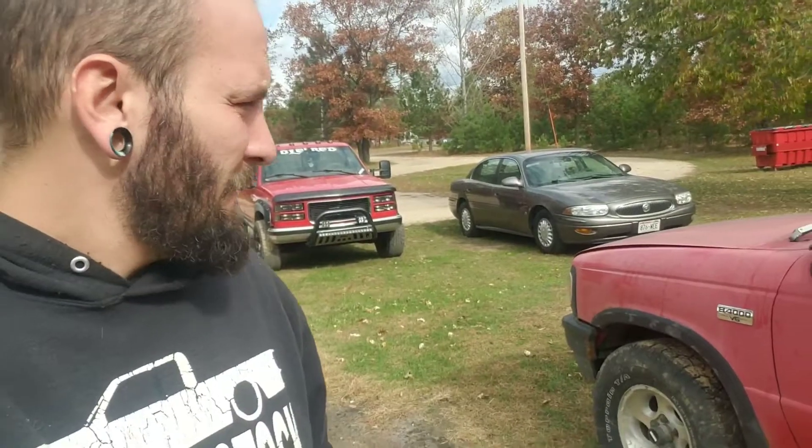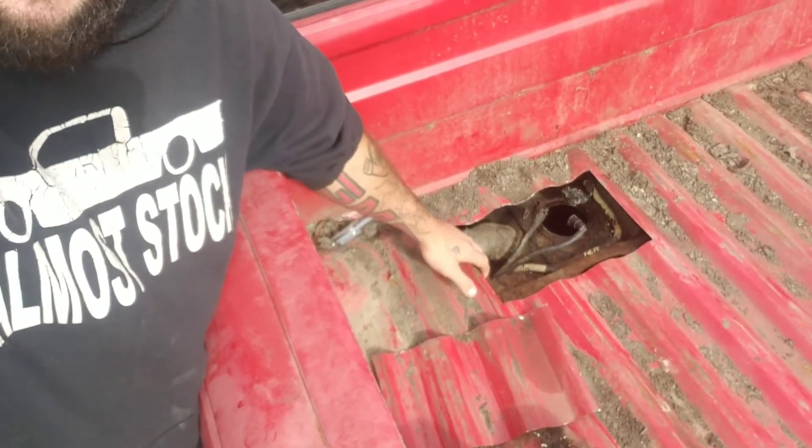After that amusing adventure my phone died, so I was unable to film the rest of what I was tinkering on here. The guy told me it was a fuel pump, and this is an old rusty truck. I could have pulled the tank or pulled the box, but you know you can just do some easy stuff — yank the bed liner out and cut yourself an access hole.